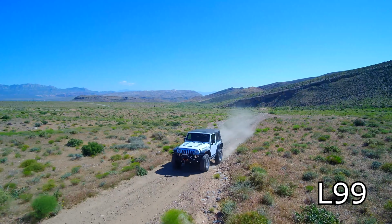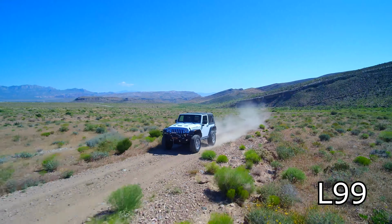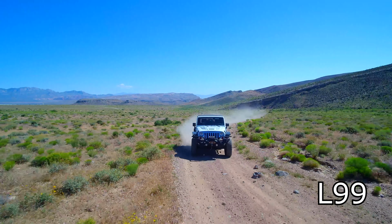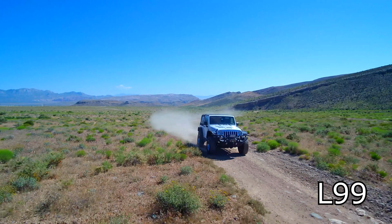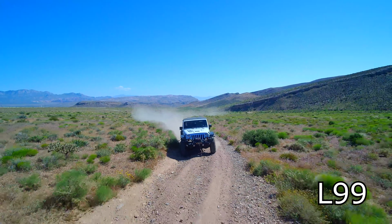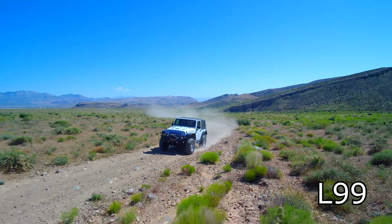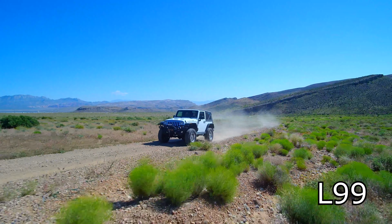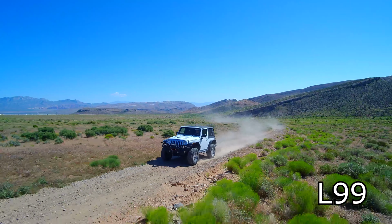If you take an LS3 and you cam it, let's say you get a 480 horse or 525 horse, or you put in a stage 1 or stage 2 cam, you basically got a 1955 small block Chevy. There is no VVT, there is no active fuel management, there's just no technology there other than a good old American V8 overhead valve engine. And that's pretty awesome for racing. There's less parts to break, tuning is easier, you don't have to worry about tuning the variable valve timing.